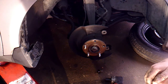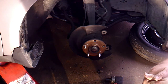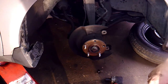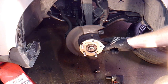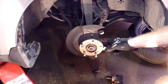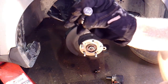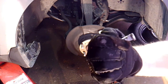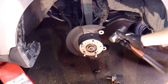I'm going to get three lug nuts. The way I do this is I use a lug nut to pull the stud back in, and I usually don't reuse that lug nut when I put the wheel back on. Now, these are pressed-in hubs on these Hondas, so even taking the axle off wouldn't let you remove the hub easily. What I do is cut a little notch — I put the stud in the grinder and grind down one corner just a little bit. I don't get into the stud itself — it's still mostly round, just a small notch — and that lets it slide in easier without messing up the threads.